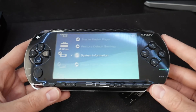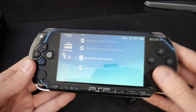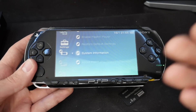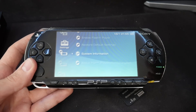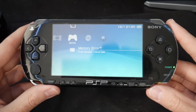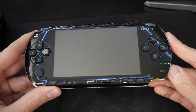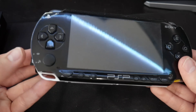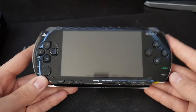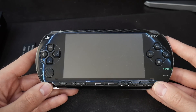This was a really cool process to do whenever I would unbrick or repair a PSP someone had messed up - I just need my battery, just need the magic memory stick, hold down a button to turn it on, press another button to install, and within five minutes they have their system that had been broken for three, six, nine months suddenly working. Now you might think you're all done, but notice: if I take out the magic memory stick and try to use any other memory stick, the PSP is bricked again.